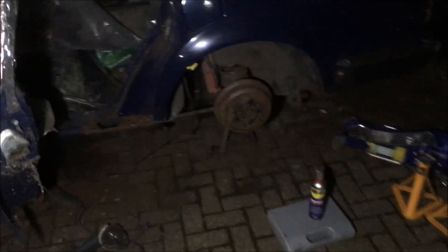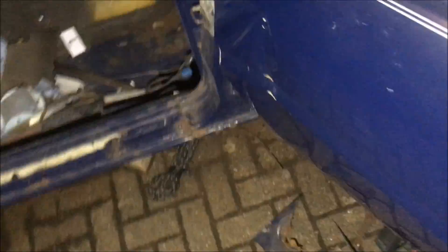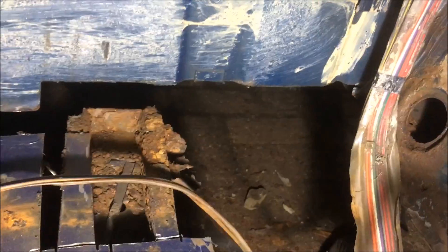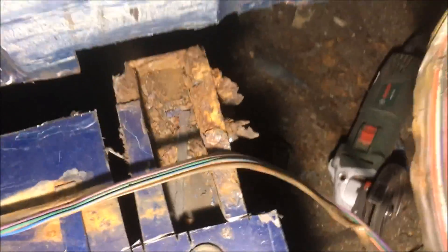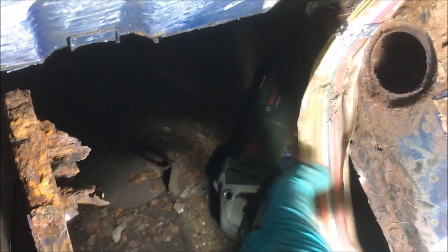I've spent the last hour out here with an array of grinding, scratchy, bitey tools beating up the inside of this Rover. I've cut out more of the floor back to good-ish metal. We can see good metal where the inner sill is along there, but it disappears and gets friable at the back — so that's all going to have to come out. The heel board is mixed news: more of it survived than it looked. I've chopped about an inch off that bit, and the chassis rail — I'll have to remake the flanges, but that's not too bad. That's where the lateral reinforcement went from the chassis rail to the inner sill — that's the bit that fell out when I pulled it with my hands.